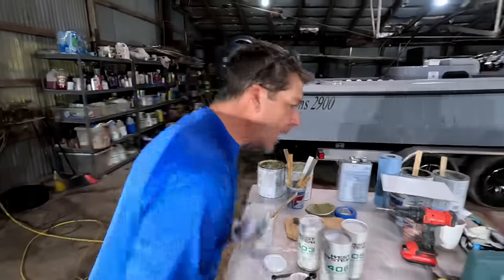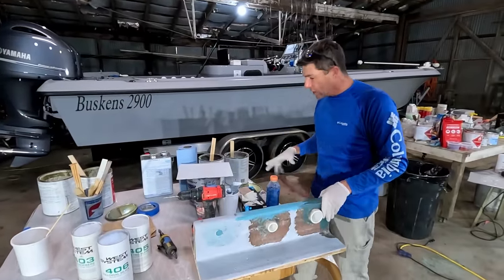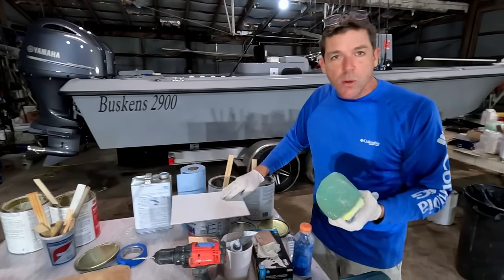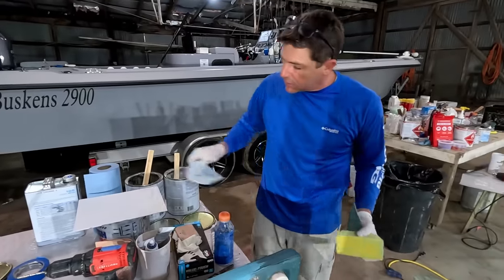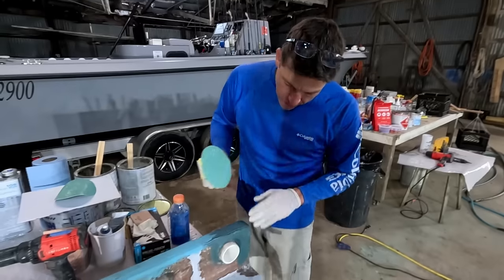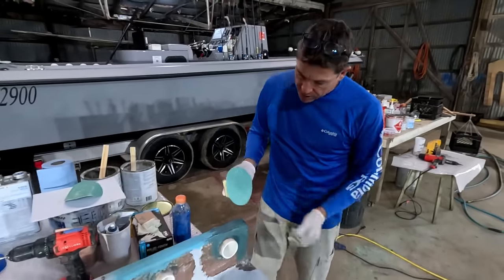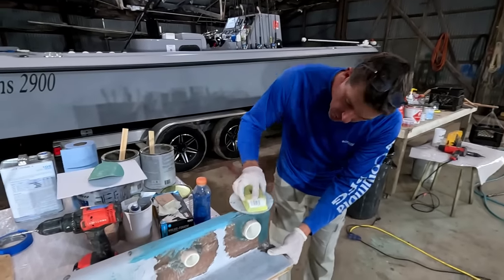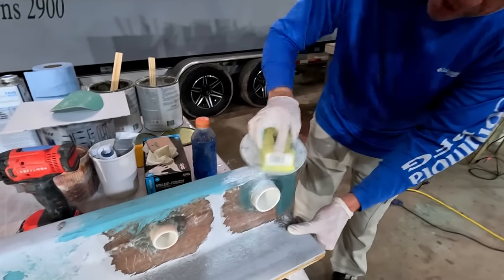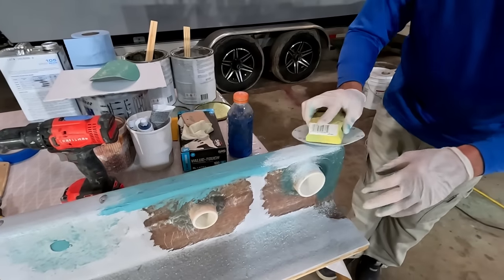While that's sitting though, I want to show you guys another little trick when it comes to getting a lot of work done and doing it professionally. And again, this is what we do for a living. So time is money, and you want to try to make things as easy as possible. If you catch this filler as early as possible, so this filler is only say 10, 15 minutes old, you can come back on it and you can make a lot of headway. This is starting to tack off. It's not quite there yet.